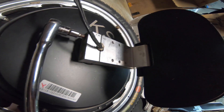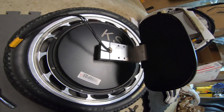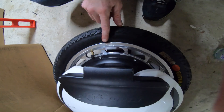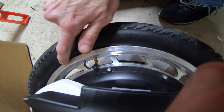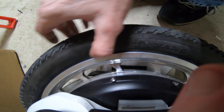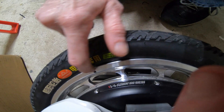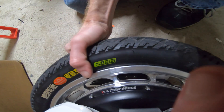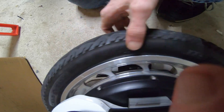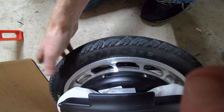While I was in here, I figured I might as well check my pedal hanger bolts — I actually found one that was loose. This wheel only has about 100 miles on it, so while you're in here, check things like that. It's all back together now. I can see the tiniest little bit of ridging where the tire bead is, and it looks a little tighter right here. I'm back down to 25 PSI where I normally run it.